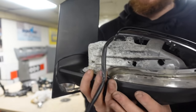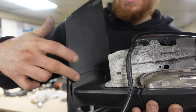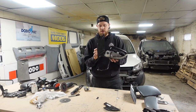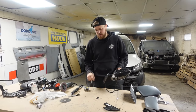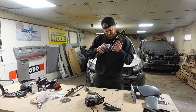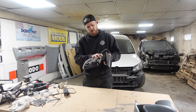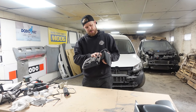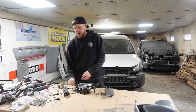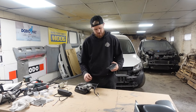What I'm going to do now is draw around this opening here onto the Touran mirror and then cut this so that it fits nicely into the opening. Then I plastic welded the outer casing or the plastics together before moving on to the next step to get the angle of the mirror correct. Both pieces are now cut, ground down and sorted, fitting nicely together. The plastic bits are the same dimensions as the other one so the mirror will be in the same place. We're going to plastic weld it together with hot staple to get it in the right area.